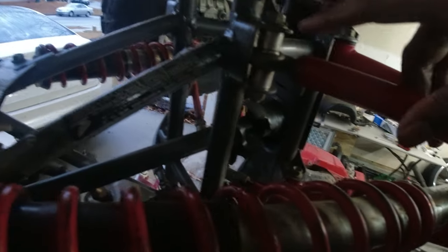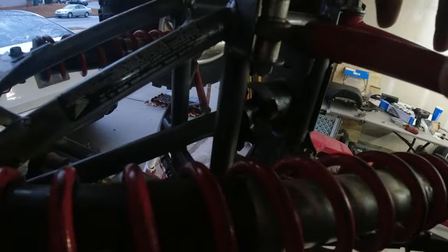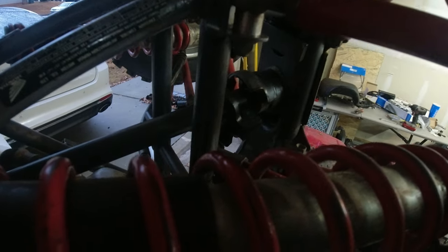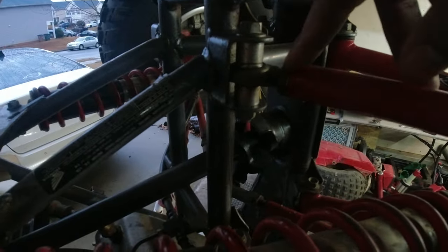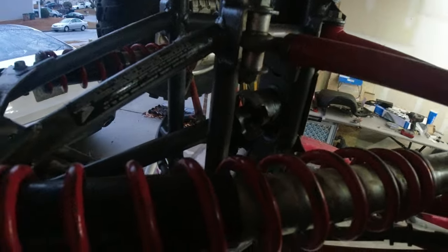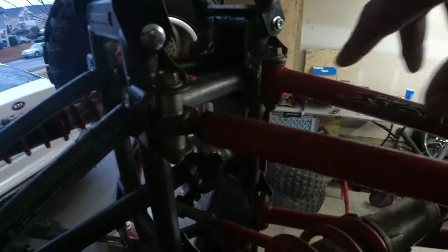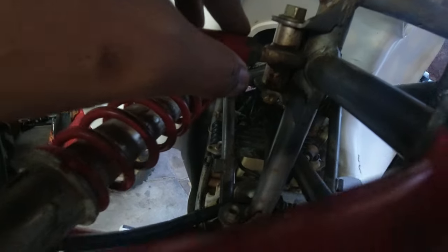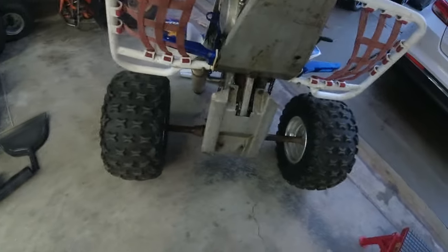What I need to do to fix this is take the upper control arm off, figure out the thread size, the bolt hole size, and the collar-to-eyelet measurement, then find replacements — they might be right-hand thread, I'm not sure. I'll replace all four heim joints. The lower Delrin bushings should be fine, and the upper and lower ball joints look fine with no play, so this is not urgent but it needs to be addressed.